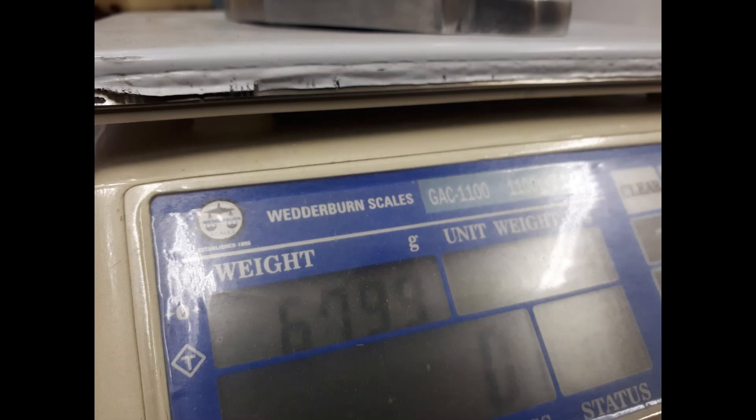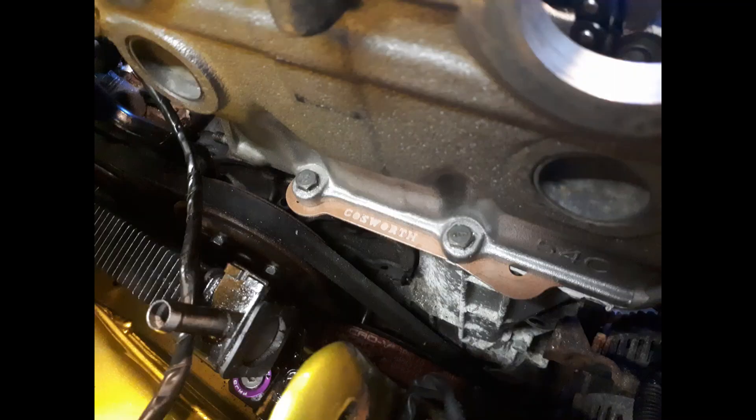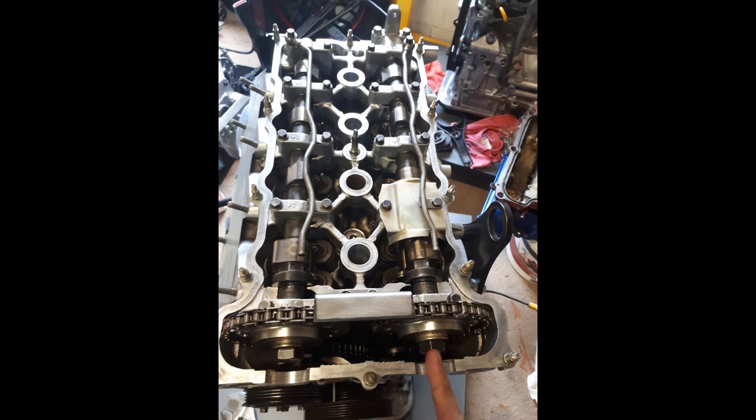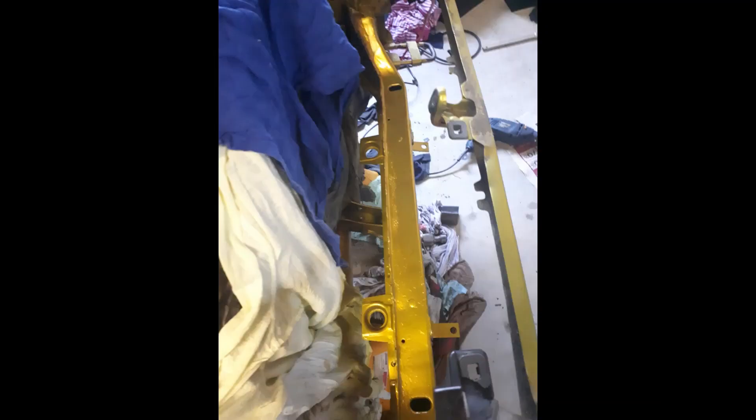I then pulled the carpet back inside the cabin and found a little bit of rust under there. Before it could take off, I angle-ground it all back, rust-killed it, and repainted under the carpets to avoid any dodgy surprises later on. Put the whole car back together, polished everything, put a whole bunch of new parts on, painted stuff in the engine bay to really tidy it up, then wet-vacced the whole interior and put a racing bucket seat into it.